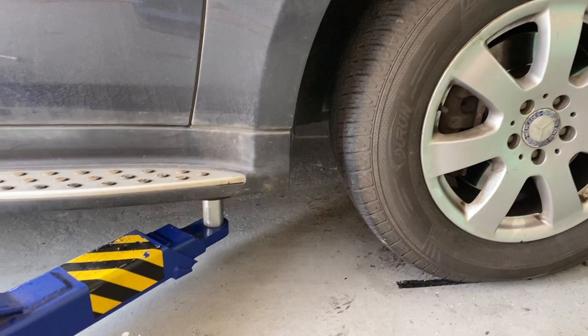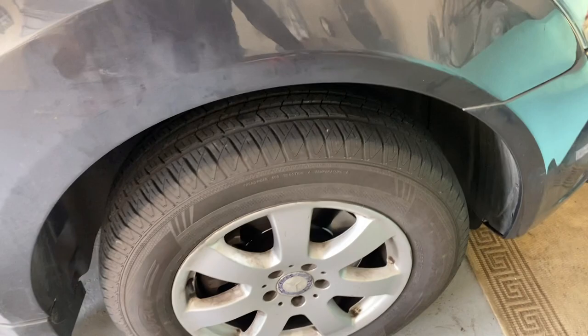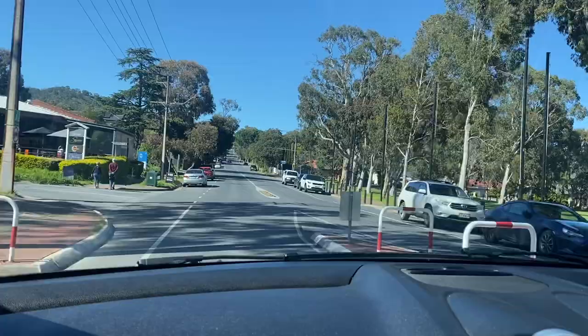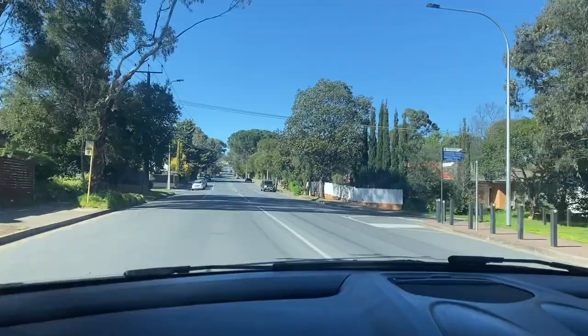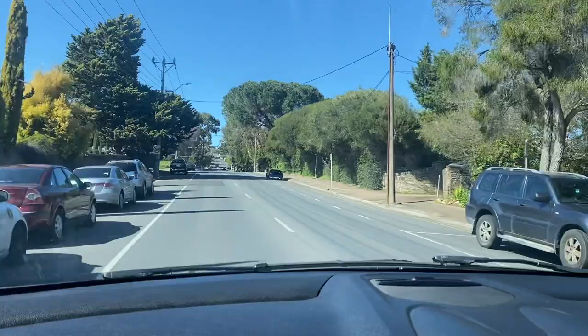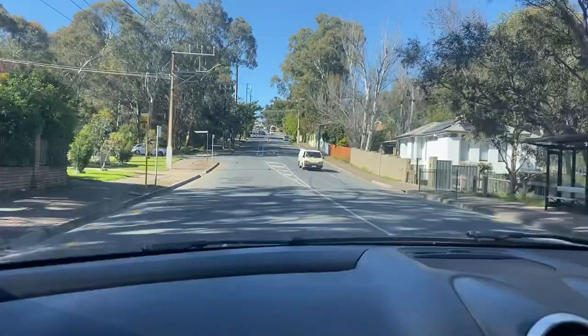It's all looking good — checking here, you can see there's no air leaks. Taking the ML for a test drive now that we've fitted that new front strut, and hitting a few potholes straight away you can see that the clunking noise is completely gone from the suspension. It's very obvious that that front strut — the shock absorber component — had actually failed. Hit a couple of potholes there, it's absolutely perfect now. There's no clunking noise at all.